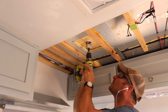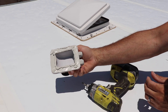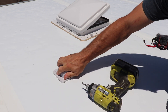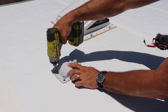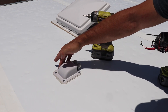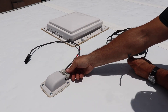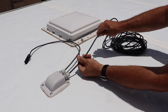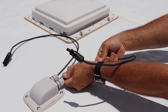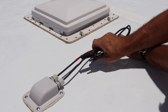The first step in adding solar to the Travel Trailer project was to run the wiring. I started by drilling a hole in the roof where I wanted the wires to run up to the front cabinet, and then I installed a specialty RV solar entry port made specifically for solar cables. I got it off Amazon for about 10 bucks. Now I'm running the solar wire into the trailer, feeding it through the front cabinet and eventually all the way down to the battery box.